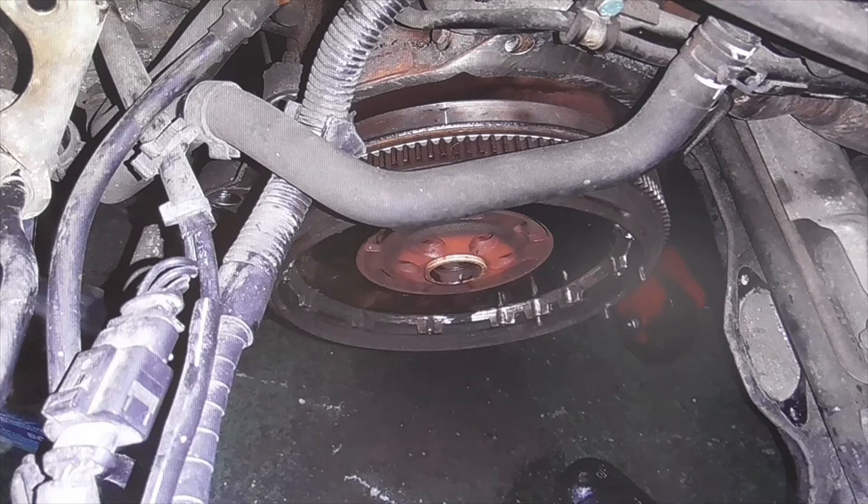We know that a monomass is going to be cheaper than a dual mass. For some cases it can be interesting. For a car like this, it is a shame to throw away a vehicle with a little more than 200,000 kilometers even though it is almost 20 years old. Having to pay for the part almost what the vehicle is worth — placing the monomass and letting the vehicle last a few more years makes sense. In normal driving you will not have problems; the damage to the gearbox or crankshaft will be very small — just a slight difference in the touch on the pedal when changing gear and some small vibration especially at low revs, but nothing more.